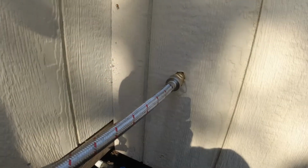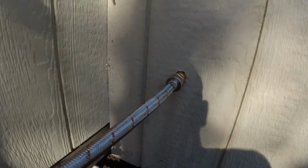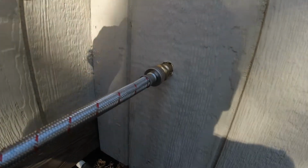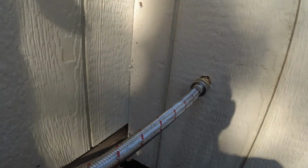with a little short piece of brass fittings. I'm not gonna have any more trouble with that. So you only have about 4 or 5 inches of brass fittings that don't have antifreeze in it. Unscrew this easy and there'll be no more problems. So that's a good fix.